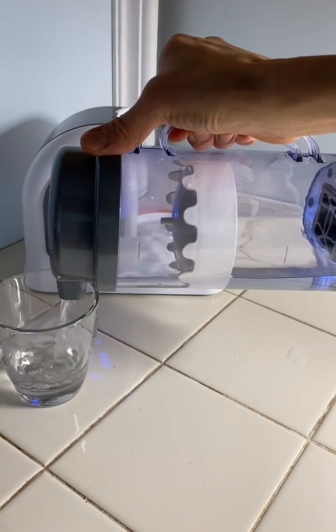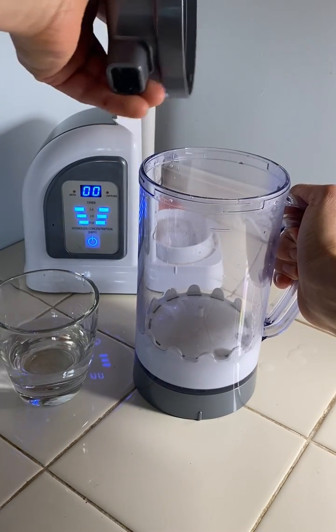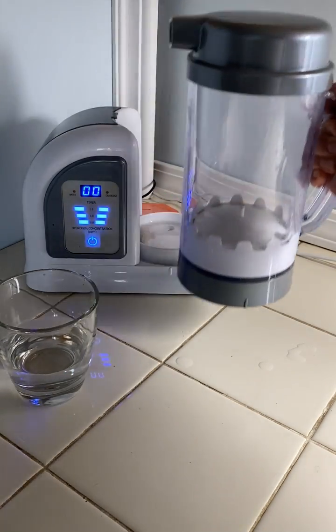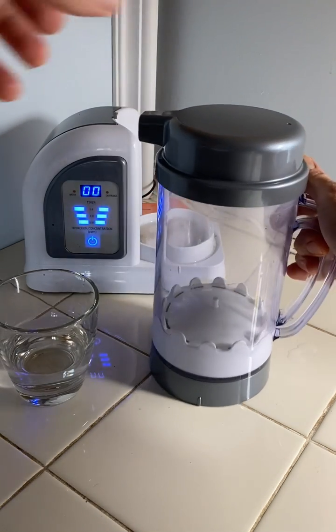This one is for the pouring of the water, but when you want to do inhalation, you'll want to take off the cap. You never want to twist this on or off while it's on the machine, because it will actually end up bending the electrodes down below — or at least it risks that.